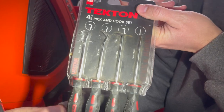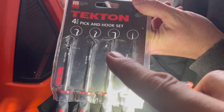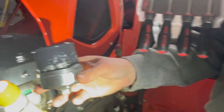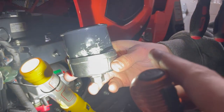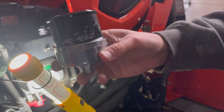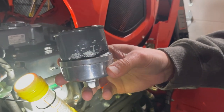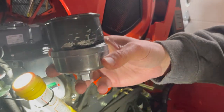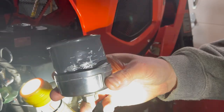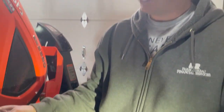I'm holding the flashlight with the wand in there. We used a pick tool to go all the way around the edge of the oil filter and broke that paint up. Because the oil filter was already mangled a little bit, we wrapped some electrical tape around it to increase the diameter, and then we were able to pound the filter wrench on it and it came loose.